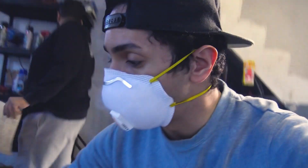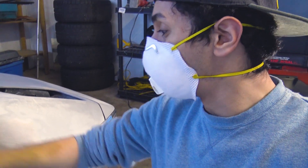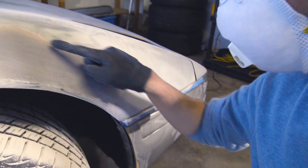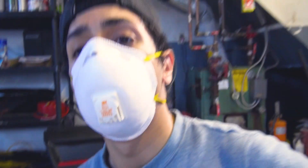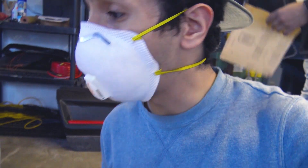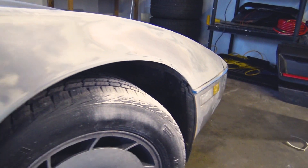The only issue with sanding a part like this is that it takes up quite a lot of time because you have to get the edge so perfect. I've put red circles here with a red marker — it's super hard to get on camera — to mark out the low spots so I can fill them up again with a little bit more bondo. The rest of the fender is actually looking pretty smooth.